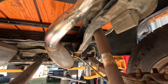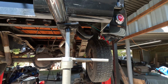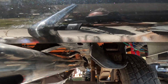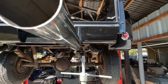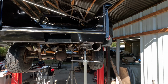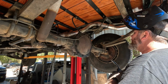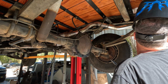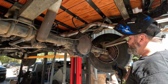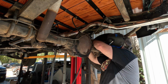So we're gonna weld this together and make it right. We're gonna come right down the frame rail, and straight out the back. Just not that dramatic. Let's go ahead and weld this up and get to the other side. I got my spacer in, nothing's touching, I got a finger around everything, and it's straight, so we're gonna make this home. Let's do it.